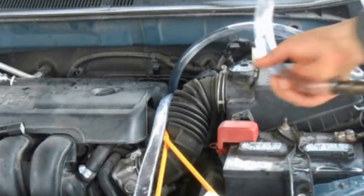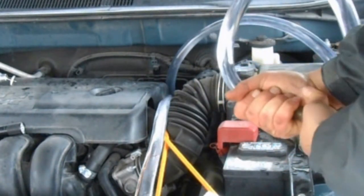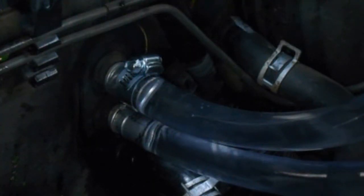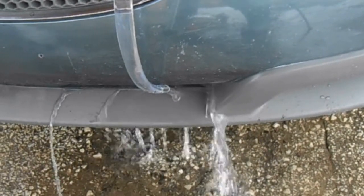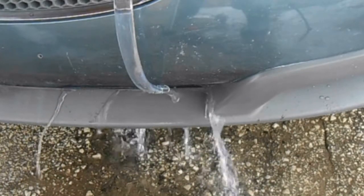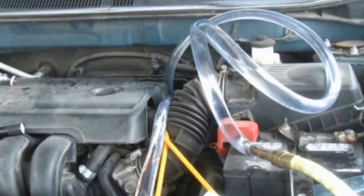With no coolant left in the core, the outlet hose can drain onto the pavement. After 100,000 miles, your heater core shouldn't be too bad. Antifreeze has anti-corrosive chemicals in it that prevent rust and other deposits from forming. Still, it's a good idea to flush the heater core and backflush it every time you flush the rest of the coolant system, every 5 years or 100,000 miles.